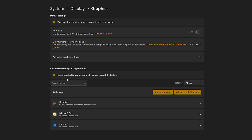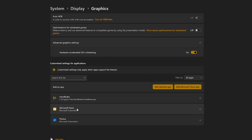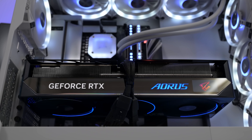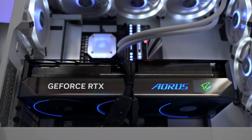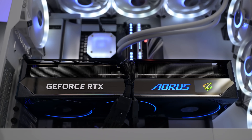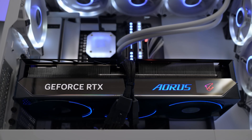Some more Windows settings. Be sure to turn on Hardware Accelerated GPU Scheduling. With my RTX 3080 Ti, this setting once activated caused stuttering and had no benefit whatsoever. With the RTX 40 and 50 series however, this setting is needed to use DLSS for frame generation — so definitely keep this turned on. All other Windows settings related to gaming I just left off.